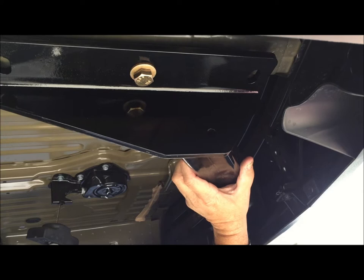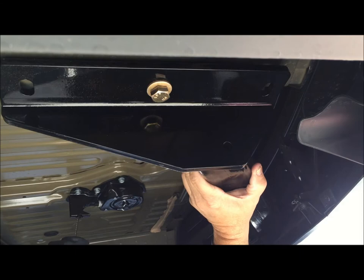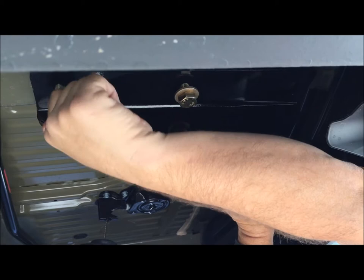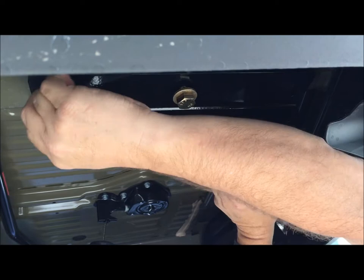At this point we've got the trailer hitch receiver into place — it was very heavy so it took the two of us to hold it up. What we did is we hand-tightened one bolt on each side just to hold it in place in preparation for the installation. Then we're going to get the other bolts in and just hand-tighten them before we use the torque wrench, just to keep it in place. Honda made this extremely easy by having the holes pre-drilled.